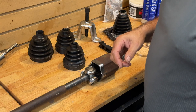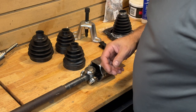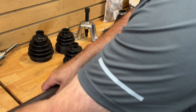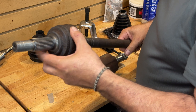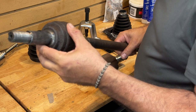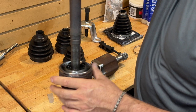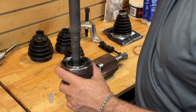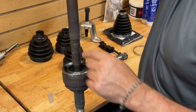We're in a little tighter here and we're just going to go over why you probably don't want to mess with your factory axle, for real. So reason number one — this is the shaft end as it comes out of the car. Your hub and wheel is at this end. This normally is supposed to just pound off. With a soft blow hammer, you strike here. Some of them are fairly specific about keeping the joint straight. And it should just pop off.